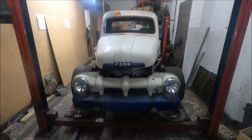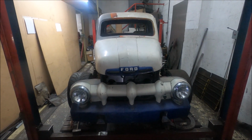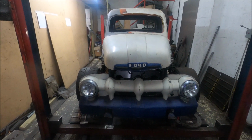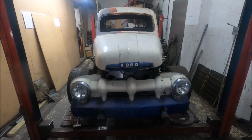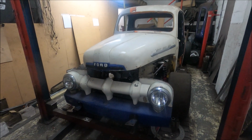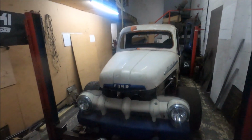It's funny, being an LSX engine, turns out there's that many little differences between those and a normal LS. Almost nothing is fitted. Rather than normal push-in core plugs, it's got screw-in ones, so they stick out further, which means loads of stuff needs modifying to fit where normally it would clear a core plug, and all kinds of crazy little bits and pieces that needed more work. But that's cars for you, and that's what you get for using what's basically a race engine, a race block anyway. Thomas can modify all that, no problem, but it just adds more work that you don't expect. But overall, badass.